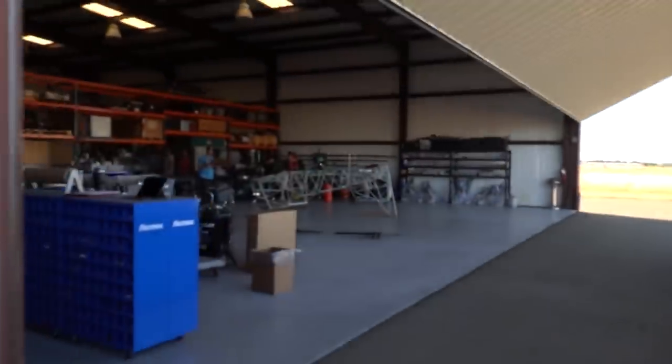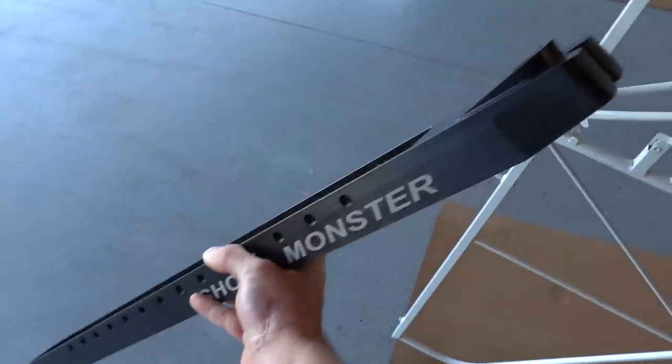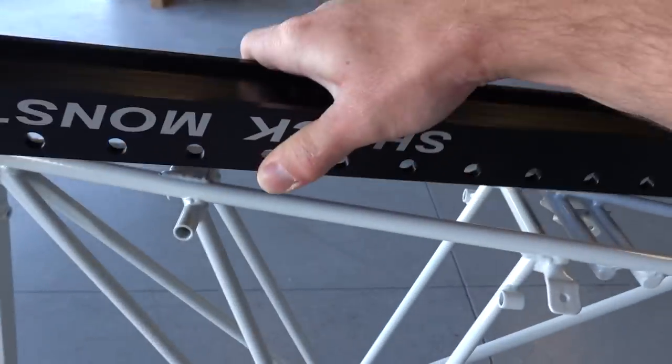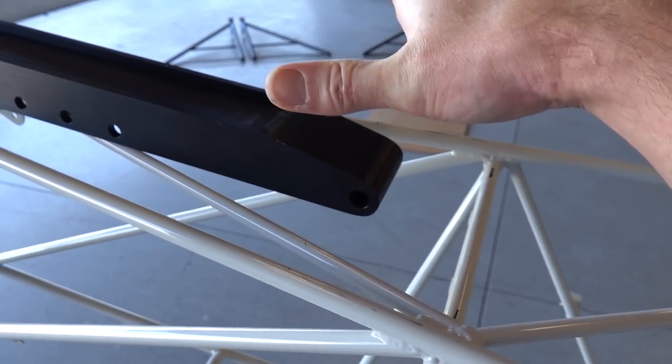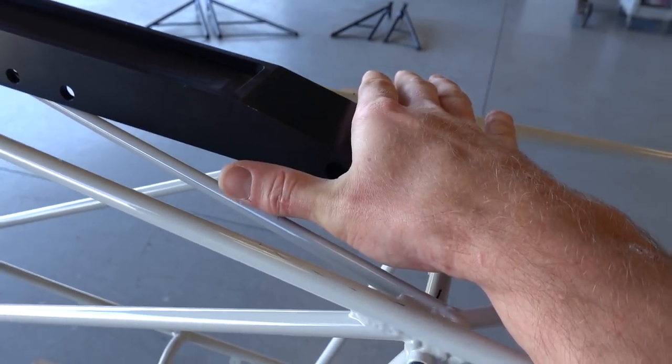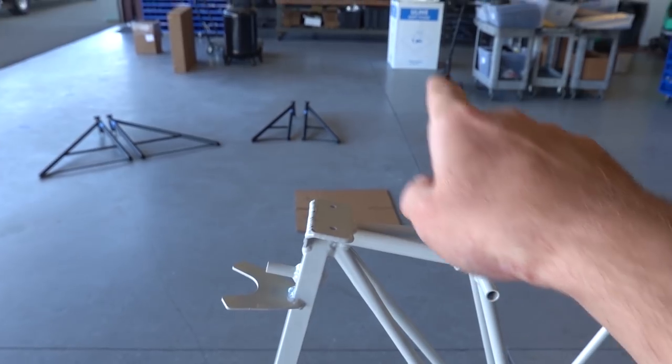We made it to Lincoln over at TK1 and got my airplane off the trailer. Tony has made these swing arms — they're beautiful, big pieces of aluminum. It's gonna sit about here. There's gonna be a plate welded in here and then a bracket that welds or bolts on top to grab the pivot. The shock will be up in this triangle piece and come out through the bottom of the airplane. Up here there's gonna be a scissor link that comes off the back and goes up to the back of this arm, and that'll give you your side-to-side rigidity.